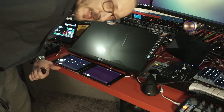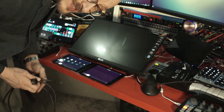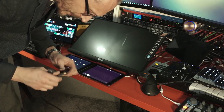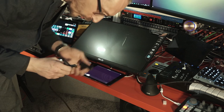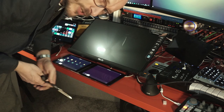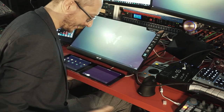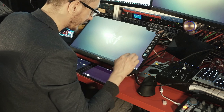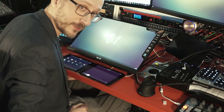I'm using a GeForce 1660 Ti graphics card, so it should handle four monitors easily. The last free port is actually a DisplayPort, but since this monitor only has HDMI, a DisplayPort to HDMI adapter should fix that with no hassle. It's connected, ladies and gentlemen, as it should be. The touch function works, but it's currently mapped to the main screen, so some additional setup is needed and I'm going to take care of that.